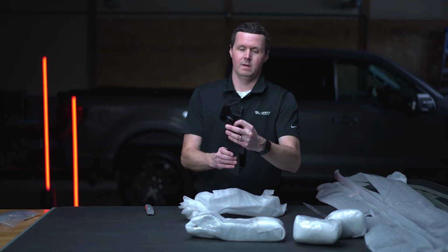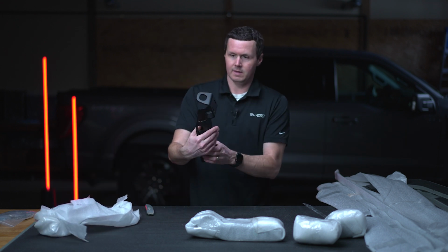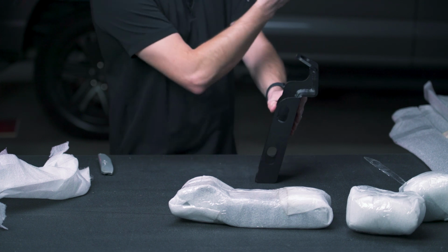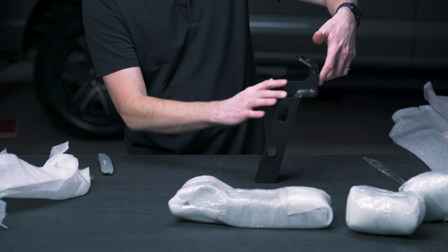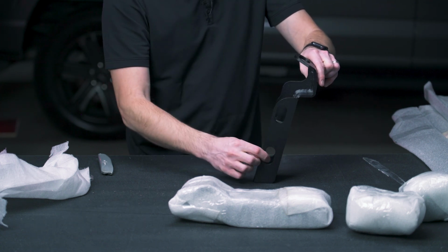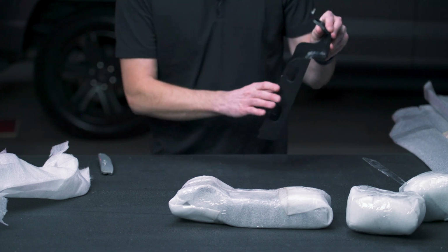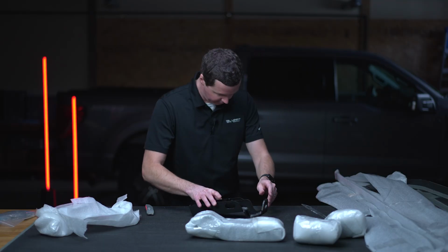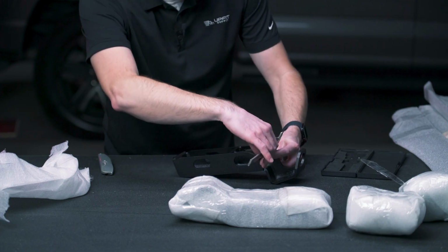Wow, this is just heavy duty bracket here. I believe this integrates into a D-ring location. So you're gonna take an existing cargo ring off of the side of the bed. You're gonna tie into those existing holes. You still get a D-ring up top. And then you have a bunch of eye holes here to tie into, and then this is gonna attach to that subframe. But I'm just amazed at how thick this metal is. It's incredible. I'm gonna take a measurement here, about 6.4 millimeters thick.